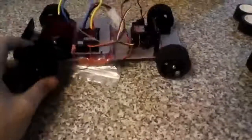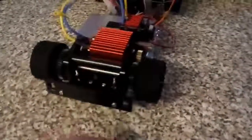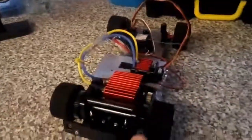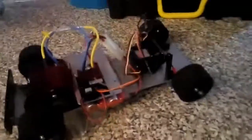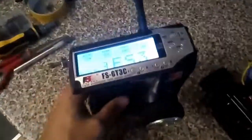So you take both batteries. So yeah, I'm just setting it up just to have a quick go of what it's like on the ultimate settings. So I've got the big boy gears, the 2246, which is a ratio of 2.09. I've got the 60 amp ESC because I don't know what the M Sonic is, but it's not 60 amp. I know that for a fact. And I've obviously got the big boy battery in there, the 9.6. So let's give it a go and see if this makes a major difference. It should make a major difference.